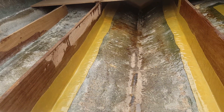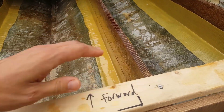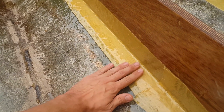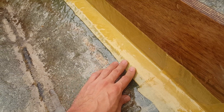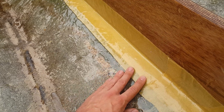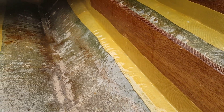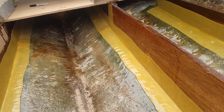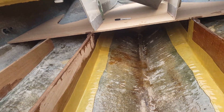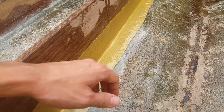Take a look here. We've got a few layers of Kevlar on this. You can see this is that repair that we made, and I can tell you this is probably a lot stronger than the hull of the boat in general. Underneath here there's 15 ounces of Kevlar, which is three times as much as we normally use. It looks good. We've also made that bond for finishing off the ski locker — got a little bit more to do along those edges to make sure we've got a sealed surface. This epoxy is fabulous.